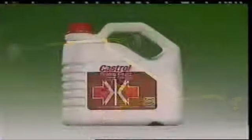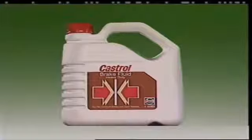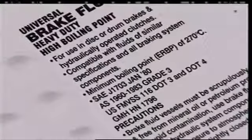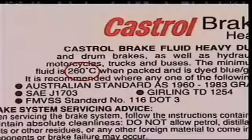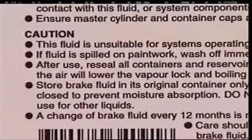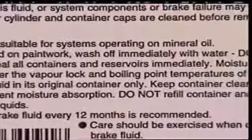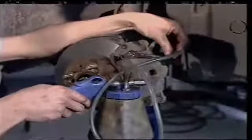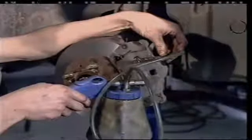This section examines brake fluid. The brake fluid transmits hydraulic pressure from the master cylinder to the wheels; it is a special fluid with special properties. Most are a mixture of glycerin and alcohol called glycol with additives to give it the required characteristics. It must have the correct viscosity for hot and cold conditions, its boiling point must be higher than the temperature reached by the system, and it must not damage seals, gaskets or hoses or cause corrosion. Glycol based fluids meet most requirements, although they do damage paint. And they absorb moisture, which is important because as moisture is absorbed, it lowers the boiling point of the fluid. Brake fluid should not be mixed with mineral based oils or solvents. If contamination is suspected, the braking system must be drained and flushed with a suitable solvent and rubber components replaced.